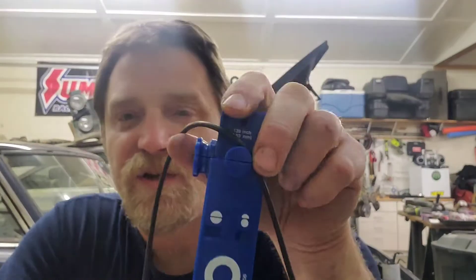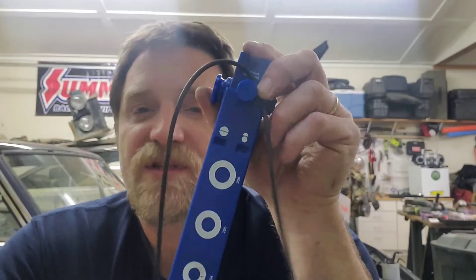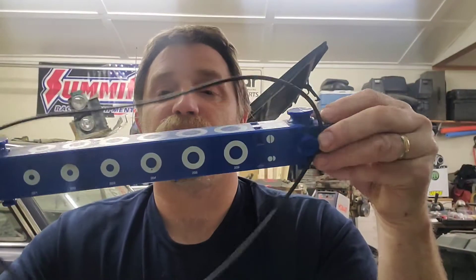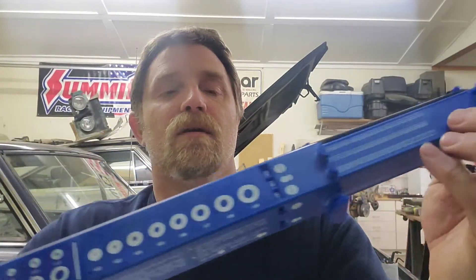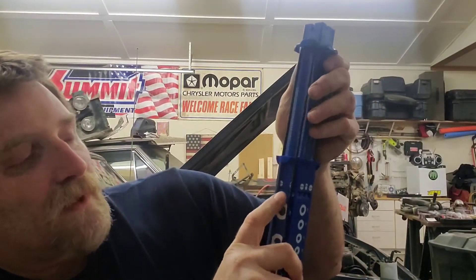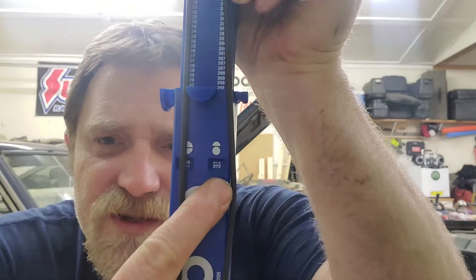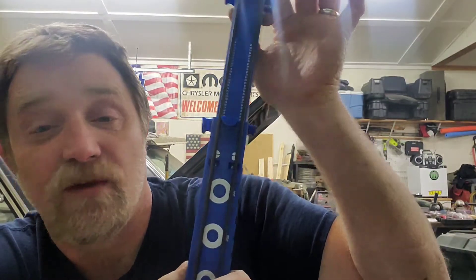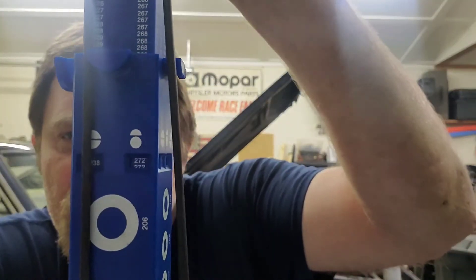We've determined our slot, or the cross section of the o-ring. You put it on this pin — you can see it has two pins or two half-moons, and then a dot, and then a half-moon. For larger o-rings you use one half-moon and then the pin on the bottom. So you slide it until it's taut, and use the scale which shows a half-moon and then the dot on the bottom. Then you have this window showing the particular size you're looking for. This one measures a 272.